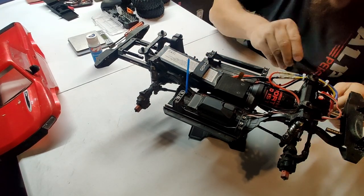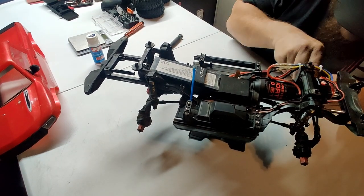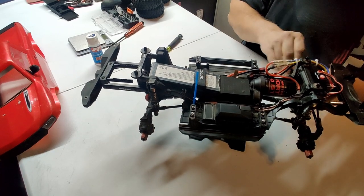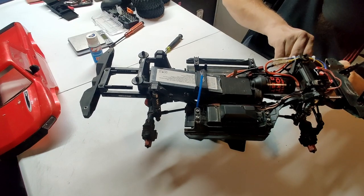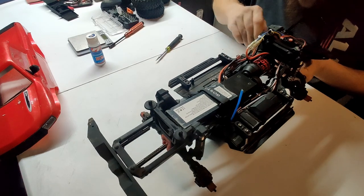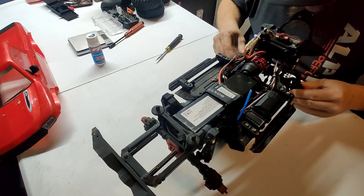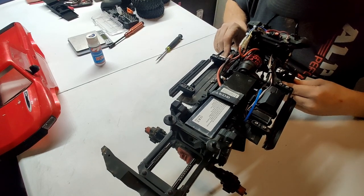Table all dirty. So I'm just gonna kinda do a little truck maintenance here. Just kinda clean it up as I go. Get my shocks off, clean around my hubs, portals. It's gonna get dirty again. But I am gonna pull these portal covers off as part of maintenance and check the grease, check tie rods and bushings in the front end, kingpin bushings. Seems like they're pretty good.